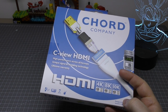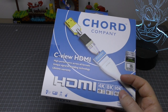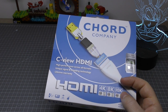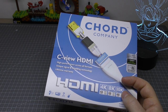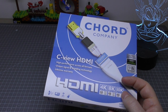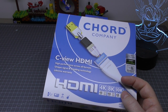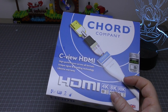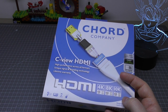Why did I pick this up? Well, if you want 8K at 60fps or even 4K at 120fps, I did my research and found out that a high speed HDMI cable just doesn't cut it for those resolutions and speeds — you need an ultra high speed. Now if you've got an Xbox Series X or a PlayStation 5, the cables included are actually ultra high speed, so you can plug them straight into your monitor or your 4K or even 8K TV and they'll work fine. But if you're using a cinema surround sound setup, you will need to check the cable that goes from your 8K amplifier to your TV, because if it's not ultra high speed, that cable will be limiting it — it just can't handle the bandwidth involved. These cables aren't cheap, they're about 40 pounds, but you will need ultra high speed if you want to connect an amplifier to the TV.